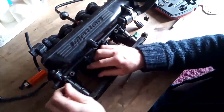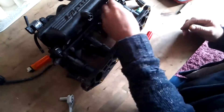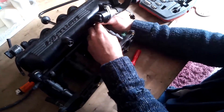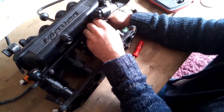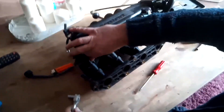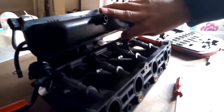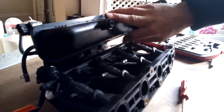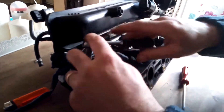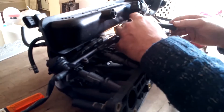All we then do is get the bolts, put them back in, and tighten them back up with the ratchet. Make sure your ratchet goes onto the lock and just very gently nip it up — probably only about five or six Newton meters.